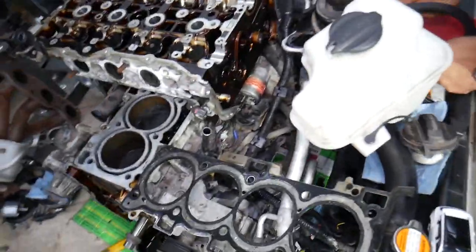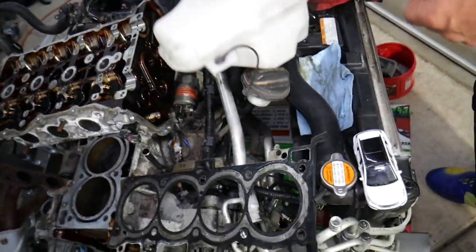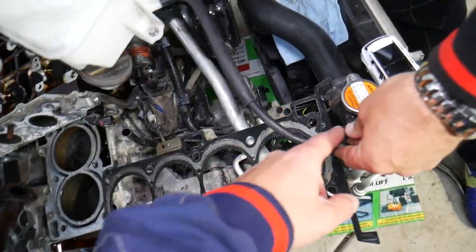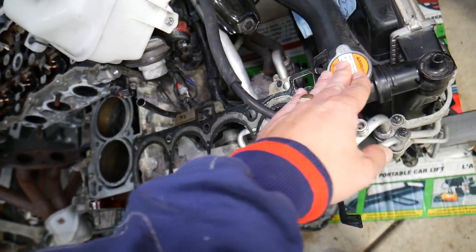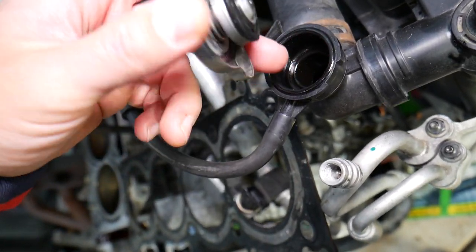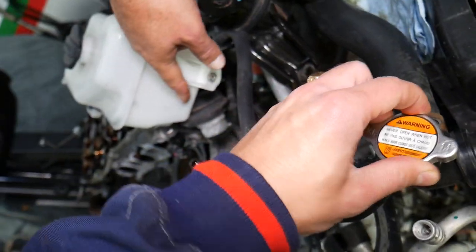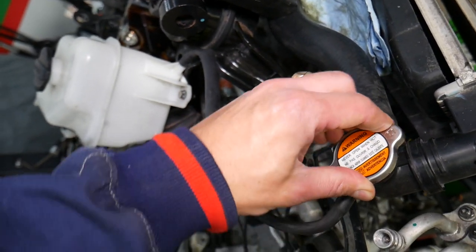So let's explain what we have specifically here. This is the coolant overflow bottle — it's connected to the radiator tank right here, or to the radiator itself. And here is the radiator cap. If you open it, on the inside you can see that when it reaches a certain pressure it's going to open and shoot that coolant into the coolant overflow bottle when it gets hot, and when it gets cold, it's going to come back to the radiator.